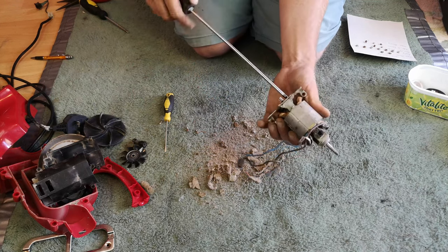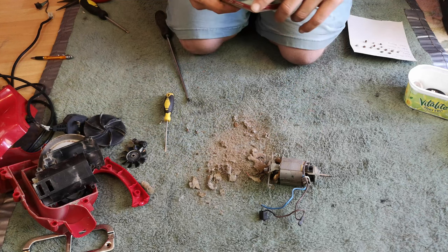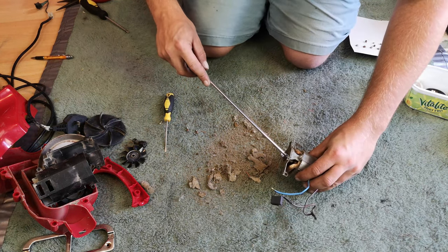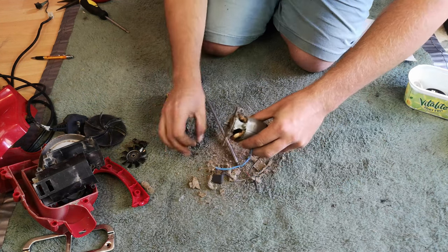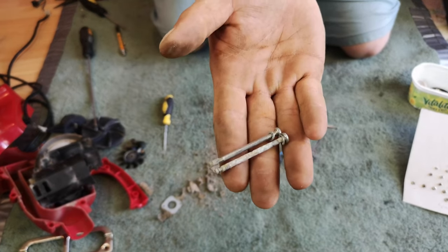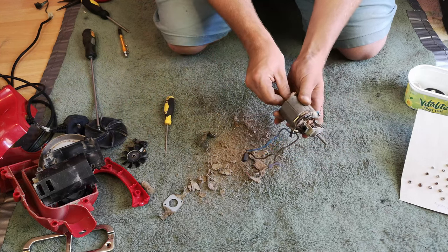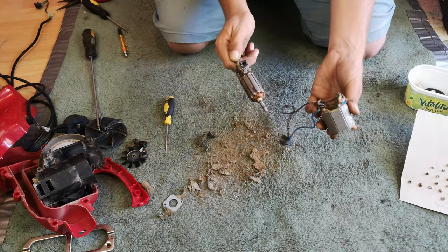Before we take off this side of the mount, I'm going to take a photograph because I always get this bit wrong. With the carbon brush pointing upwards with the live side - because this is a handed assembly - if you get it wrong you suddenly can't put the rear housing back together. We'll take out this last screw which takes that bracket off, then the longer screws which go all the way through the coil. The problem with these little vacuums is they always get stored damp or chucked in the shed or loft - that's what does the damage.